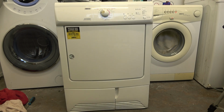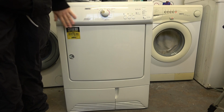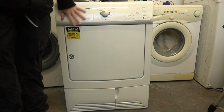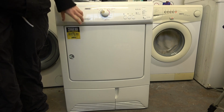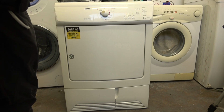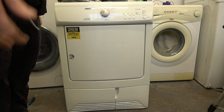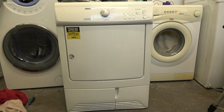So there we go. What to give this out of 10 then? I personally, at this expense, would have put a drawer at the top. They should have put the collection water tank at the top, not the bottom. And for that, it's going to get 9 out of 10, and that's the only reason why. I personally think that should have been put up there just due to the pricing point. But other than that, they tend to be more reliable technically if they're at the bottom, since you're not dealing with a pump fail or any blockages.